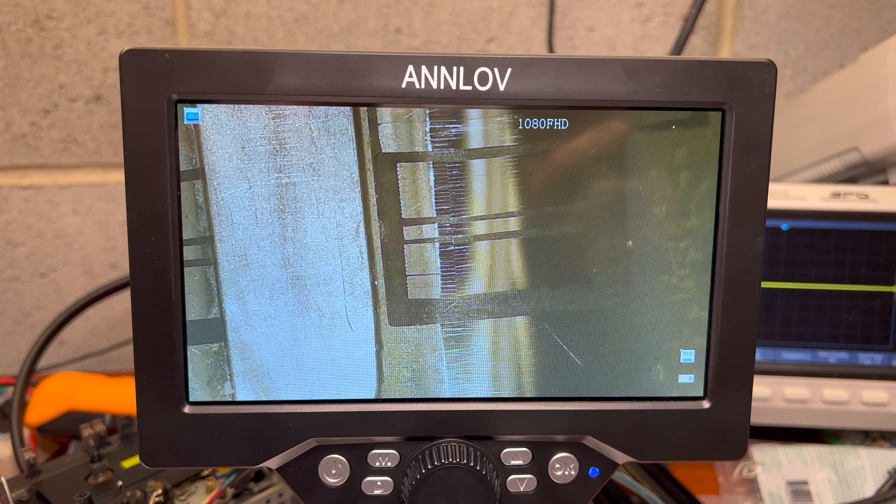Here are the final results. As you may see, this is the record head — nice and straight gap. Here is the playback head; I'm trying to get the gap shown to you. Let me change the light a little bit. Hope you may see it — it's right there in the middle of the screen. That's how the gap should look: thin, straight, and almost not visible.